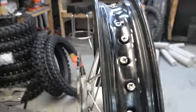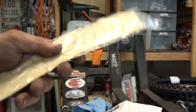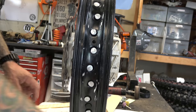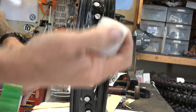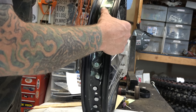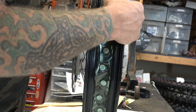We've got everything buzzed down with the flapper wheel, gone over again with the abrasive wheel, then brake cleaner, soap water, and air dried with the hose — super clean. Now we stick these little barriers on to cover up the spoke nipples so they don't tear through the lining. Got all those on. Now we apply the double-stick tape — smooth side out — then we'll remove that protective layer to get the actual band on. Going easy at first since we'll come back with a heat gun.